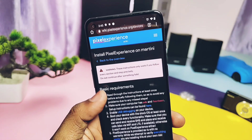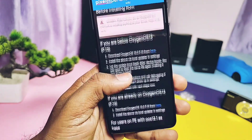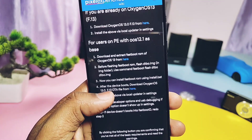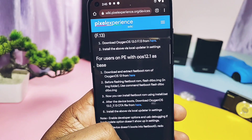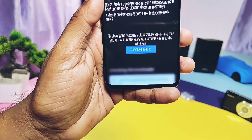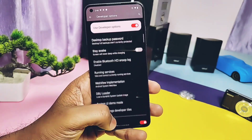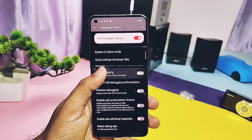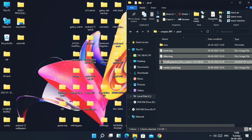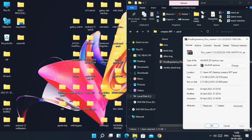If you are on OxygenOS 12, then follow the video given in the i-card for flashing OxygenOS 12 on both slots, then install OxygenOS 13 F14 on both slots of your device using local install. Don't use OxygenOS 13 F15 as a base — that works for installation but may cause some bugs in the ROM. After that follow the instructions I'm showing now. If you are already on any Android 13 base custom ROM, you can also start from these steps. Your device bootloader must be unlocked and USB debugging must be enabled. Download boot, DTBO, vendor boot, and the full ROM zip file from the links under the video description. Other device users should follow their own flashing instructions and files.